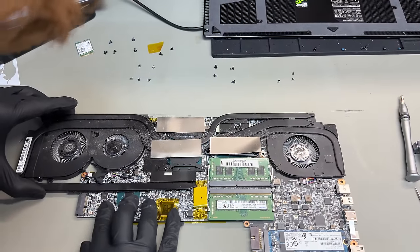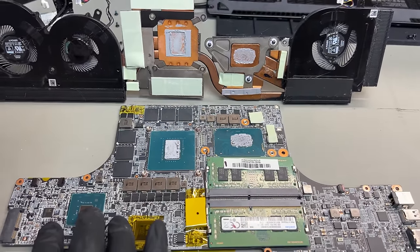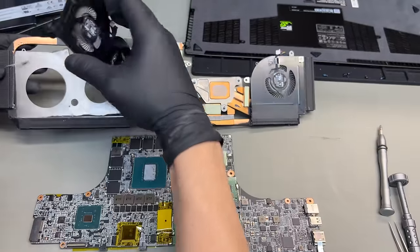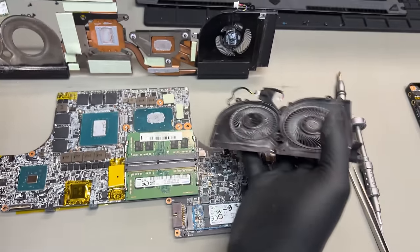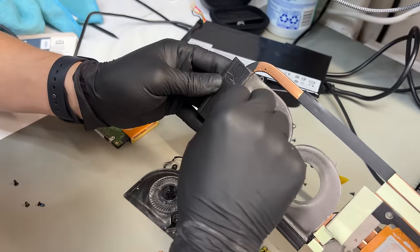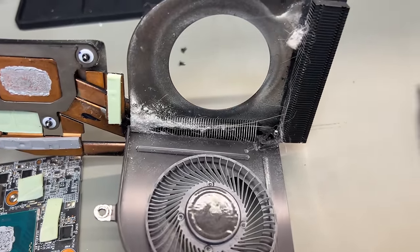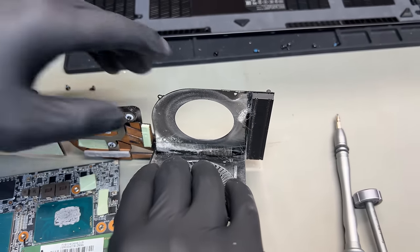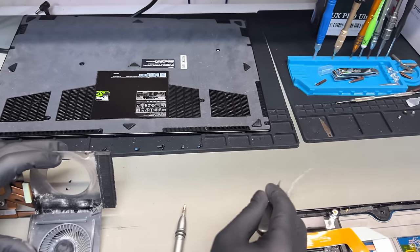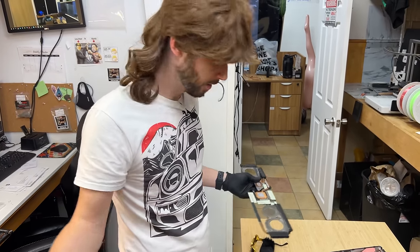The silicone actually doesn't look bad at all. Those are bird pubes. Not that bad. The old thermal paste needs to be removed, and you have to be careful with these because the pipe bends easy. So you have to be careful when you're cleaning it — not to put too much pressure on it. If you bend the pipe, you're going to mess up the cooling system. You want to put your hand behind whatever you're putting pressure on. I already did the chips while Lupe was taking a dump. Time for some PTM 7950.